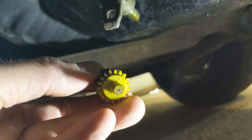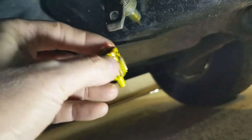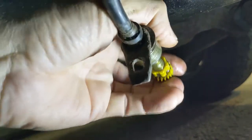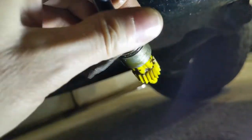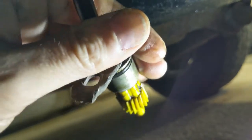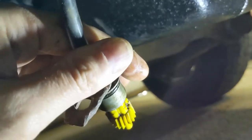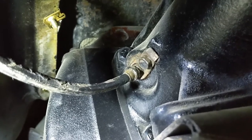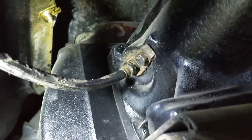I have what I called brown earlier but it's actually tan — a tan one and a yellow one — so an 18 and a 19 tooth. I'll be putting this back together. It just slides over like that; you have to align it with the square of the odometer cable, and the little clip goes back on right there. All back together — that's a 10 millimeter, because it's a transmission from an early 80s Ford truck.